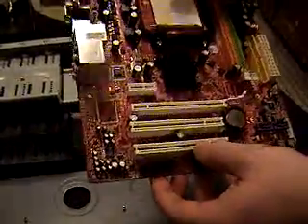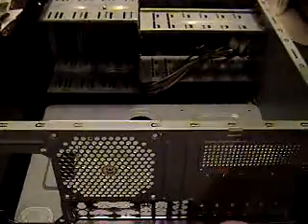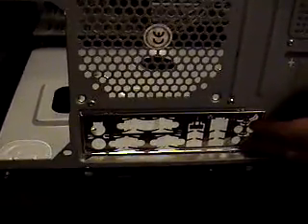We got a single core processor. When you open your motherboard box with your drivers, software, little hardware pack, and all — it's got all kinds of goodies in here, a little adapter, serial ATA cable and all. What you need to do is find your back plate, and your back plate pops in here, where we took the generic one out to begin with.